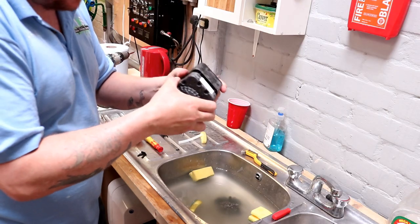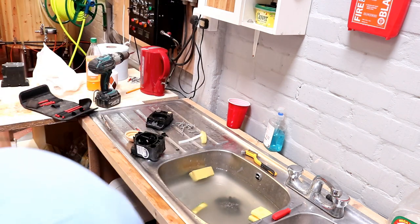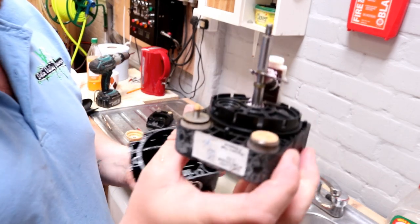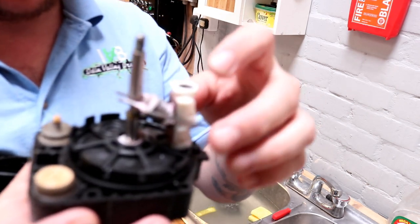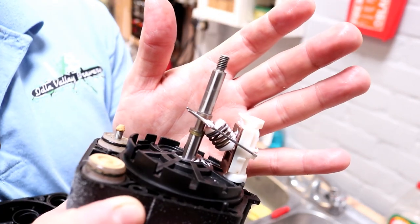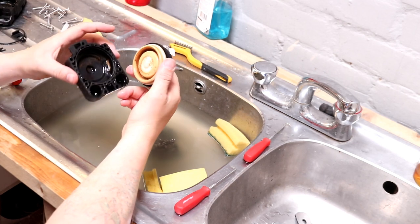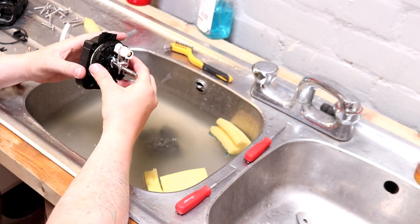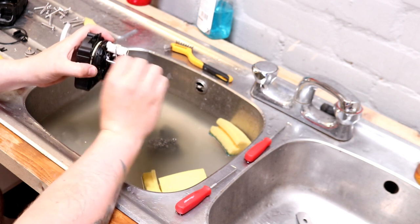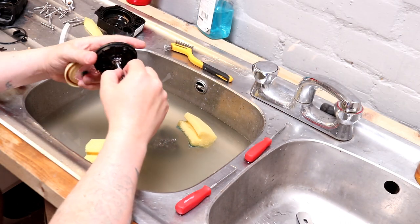So there's a big O-ring on the floor — he sits around the edge. And then on the inside you can see the gas pump mechanism. I actually had one of these come off the other day. But if you get this off, just have a look at that — there's a nice little cheat sheet for you to repair it. You can see how the two rubber grommets are top and bottom. There's another diaphragm at the back. So we have two active diaphragms, and this middle section just moves backwards and forwards, pumping on each stroke.